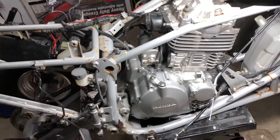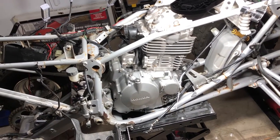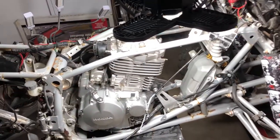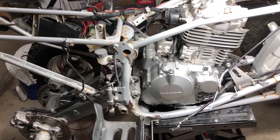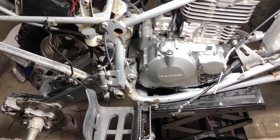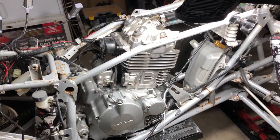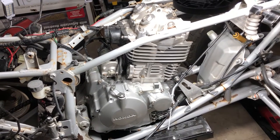Yeah. So what you want to do first is get down to the point where I am so you can continue on. I should have recorded this, but I totally just got to town and started working. So you want to make sure that you get the exhaust off, plastics off, of course, and the gas tank off. I have the carburetor off because I was doing other things, but yeah, you want to get down to this point. Also, remove your brake lever, get all that off, and get to this point, and we will get this top end torn all the way down to the piston. We're gonna have to take the jug off and replace that bottom gasket down there, the base gasket, and we're gonna plane it up. Let's get started. Let's get this baby taken down and get to town.